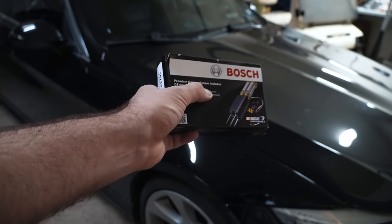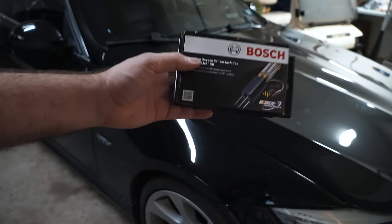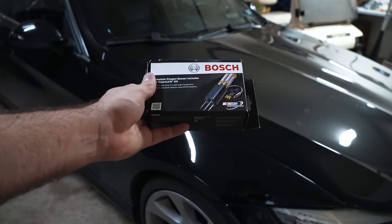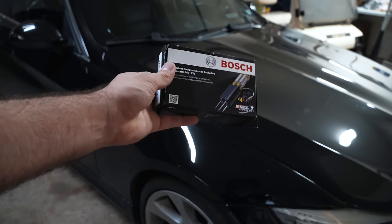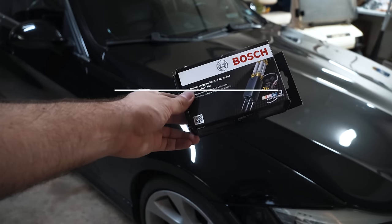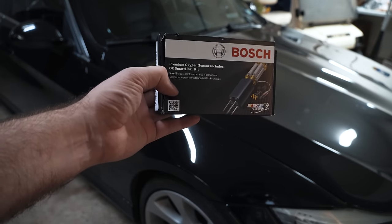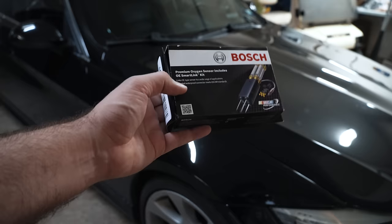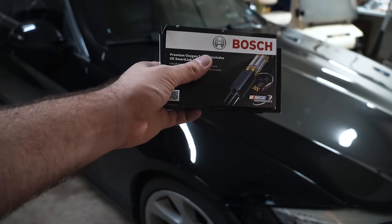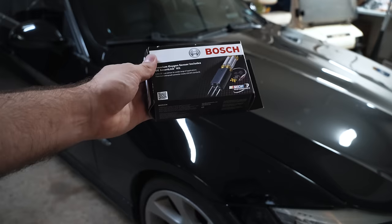A lot of people probably neglect their O2 sensors. It's strange that the MSD80 couldn't tell me my O2 sensor was bad when it was such a simple thing for the MSD81. But it's part of the progress. As soon as I got that code, the car ran differently and actually started to pull like a beast with zero misfires, because I think it just disregards the sensor and runs off a base table to get you by. Huge difference.